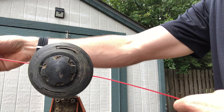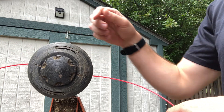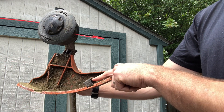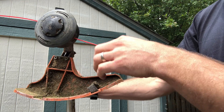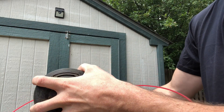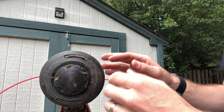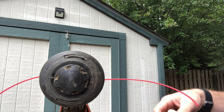Okay, that's it. It doesn't matter if it's uneven — you're going to go for about five inches on each side. When you start it up, on your guard there's usually a little steel cutter that will cut your string to the correct length of five inches. So that is method one, the preferred method for the C25-2. Super easy, especially when you get the old string out.